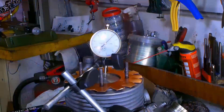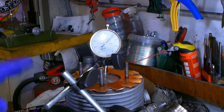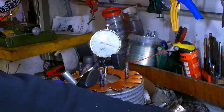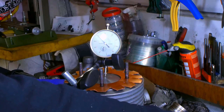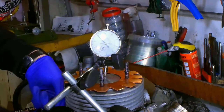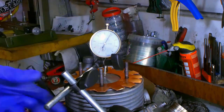Our head is ready. Going back to the engine, the first thing we do is checking the top dead point and blocking the flywheel so that the piston will remain exactly in this position, allowing us to measure the compression ratio. So I'm turning it while holding the engine and the flywheel and raise the piston until it reaches the highest point. Okay, this is it. A little further back. We blocked the flywheel. Let's take the comparator away.